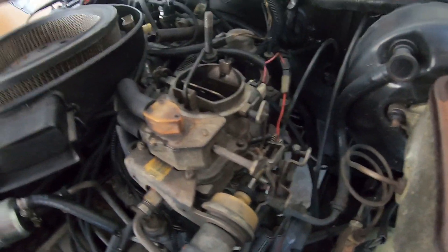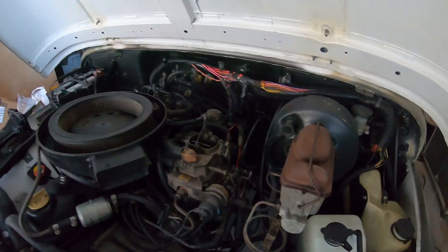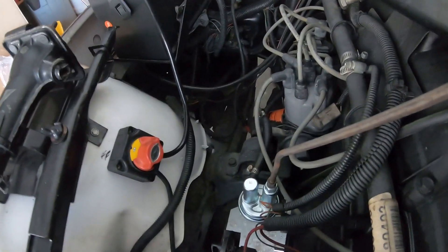We're going to be doing that carb swap. We're going to be doing what's called a Nutter Bypass, which basically reroutes these two wires from the distributor over to the ignition control module underneath the coolant recovery bottle down there. We're gonna splice into those two wires, connect them up down there, put on the new carb, and we're also going to time the motor and set it to 8 degrees.